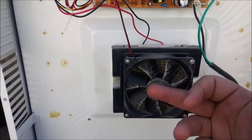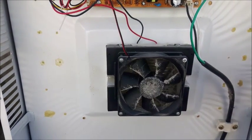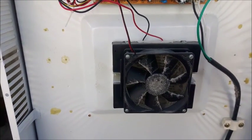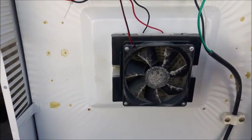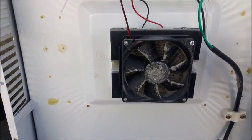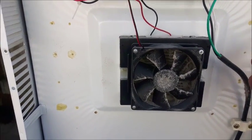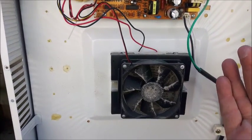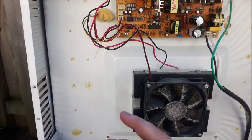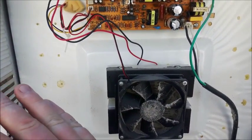It's in a refrigerator and it has a cooling fan to help keep it much cooler. It's not for built-in applications, which is fine by me. What I'd like to do is put this in my shop and run it off 12 volts from my battery bank - that would be perfect because then I'd have an off-grid fridge. I already have an off-grid stereo system in there, so I'd love to have an off-grid fridge too. I'm going to first try it with the thermostat disconnected to see if that was causing the issues.